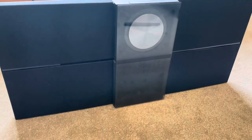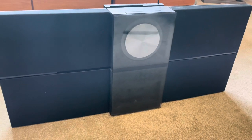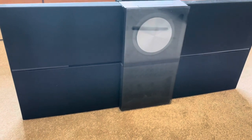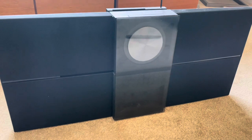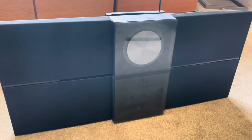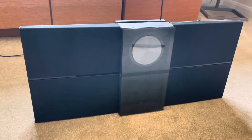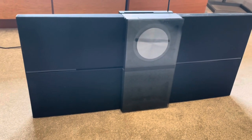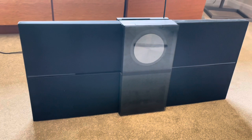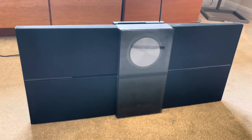It's the newer type with the stainless steel clamper, rather than the black clamper which I think is ever so slightly more desirable. I think it's also got the CD-M12 laser in it, which is an up and down one rather than an arc like the earlier ones. Either way the CD doesn't work so we're gonna have to spend some time looking into that. It's also in black so it's not really going to divide any opinions — let's see if I can fix it.